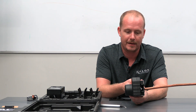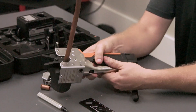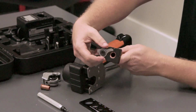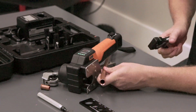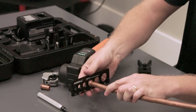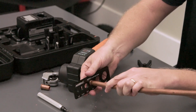Once it gets to the end, it backs back out. Release the clamp and pull it out. Now I've got what looks to be a perfect flare — it's got a nice smooth edge on it because I made sure to deburr it. Open it up and check it against a flaring gauge. It should go in and then stop so it doesn't go all the way through. Then we know that it's a perfect fit.